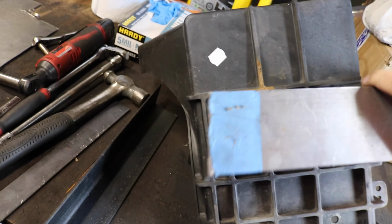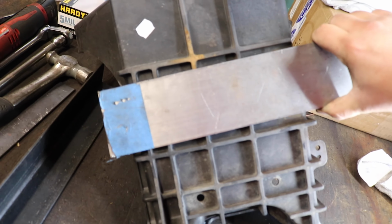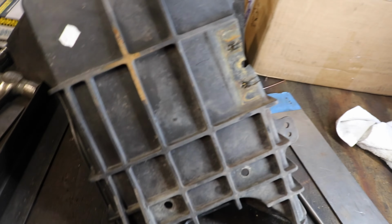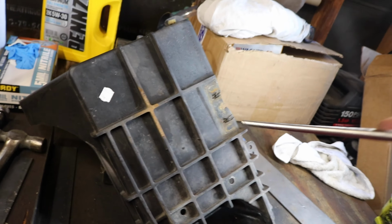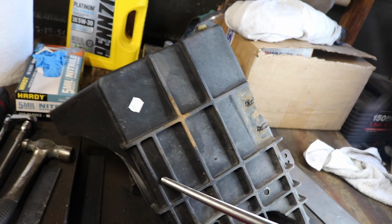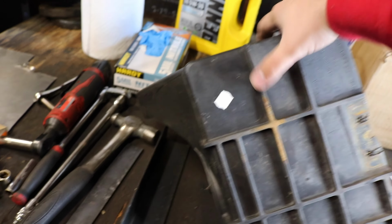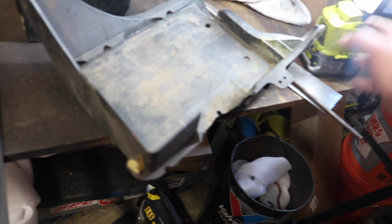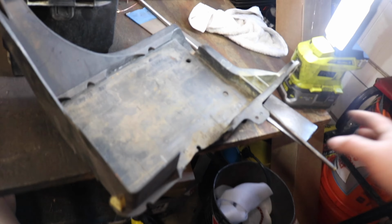Okay, so I'm gonna cut out these sections in the middle here and put this bar in like this. That's gonna make up our mounting plate on the bottom. Then run 3/8 rod through that bar. It's actually going to go through the bar and through the bottom of here to further secure it. This side, I'm going to cut down to clean it up, and then get everything cleaned up, get this nice and brand new looking again, get the metal in.